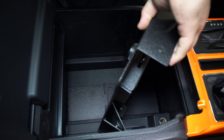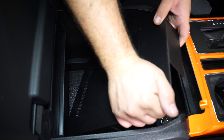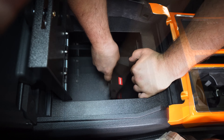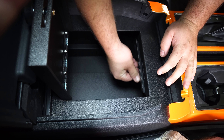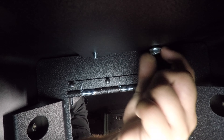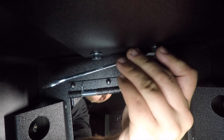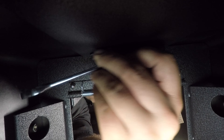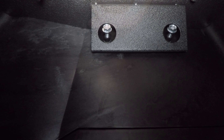Place the vault in the center console. Lift up on the vault — you have to really pull up on it so you can get the bracket underneath it. On the front and back of the vault, you'll see there are two studs where the top of the vault attaches to the bracket. Install the provided nuts onto those studs. Once you get the nuts installed on the front of the vault, install them on the rear as well. The nuts can be tightened with a 13-millimeter wrench. Finally, there are two screws that have to be installed on each side of the vault. Once you get the screws started by hand, tighten them with an 11-millimeter socket.